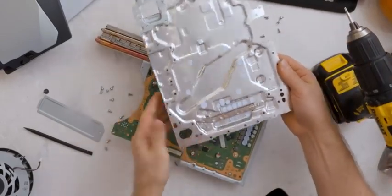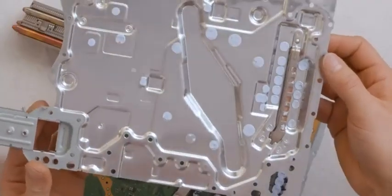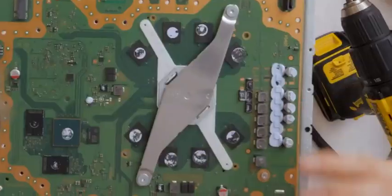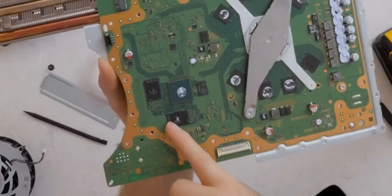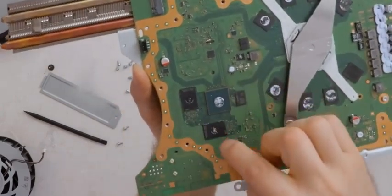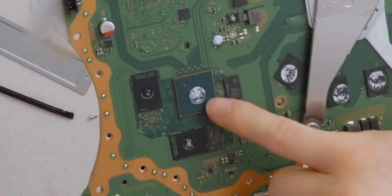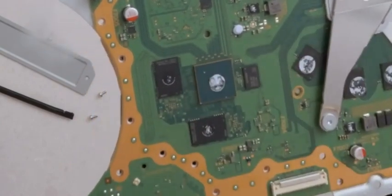Wow, that is not a lot of thermal compound. They've just got little dots on each of the DRAM packages and the NAND packages too, actually. We're looking at 16 gigs of GDDR6 from Micron here. Here's our NAND packages for probably half of our 1 terabyte of storage. And then here's our chipset as well as a DRAM cache, presumably for the SSD here.